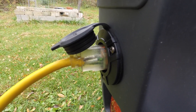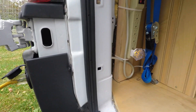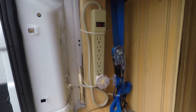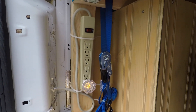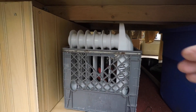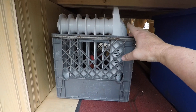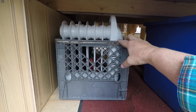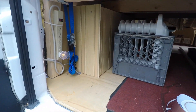We got it all done. It's all hooked up and all screwed in. I've got shore power hooked up to it, and here's what my setup looks like for bringing shore power into the van. I'm probably going to run extension cords to the front so we'll have access to AC power. The rest of the van will be DC. I have this little electric oil heater, so if it's cold outside and we have shore power, we'll be able to run this little electric heater and not have to worry about CO2 in the van. One more hole in the van though!